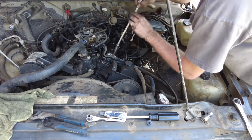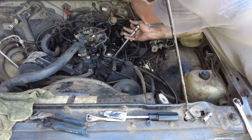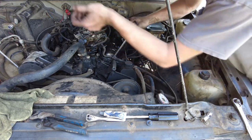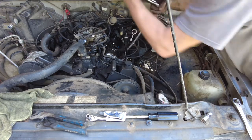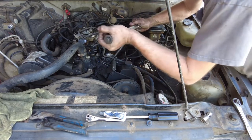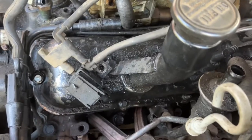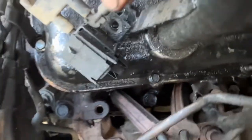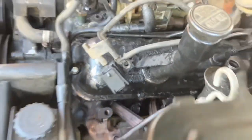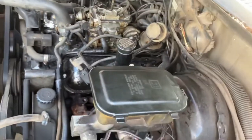About seven-eighths of a circle rotation. There it goes — 15 foot-pounds. Now let's get the oil filler cap back on there. Remember on this side, you need to put these vacuum lines back on there — they line up like so. This is a two-hand job. After this we're going to try to hook everything I took apart back up.